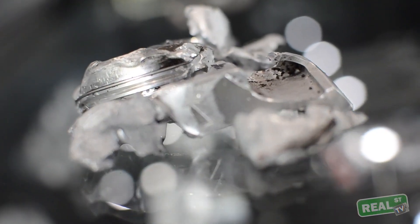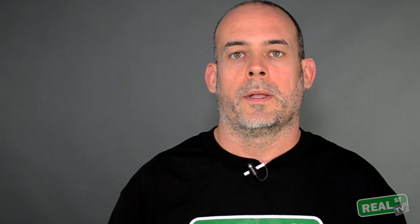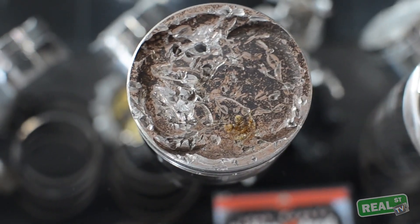When the pin breaks — if you use a standard pin and it breaks — it is a catastrophic failure. Everything that was your engine goes in the garbage and you have to start over again, because when it breaks, the small end of the rod is now free to roam, knocks a hole in the cylinder wall, and you've just got a bunch of stuff swinging around. It just turns into a real ugly situation.